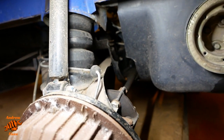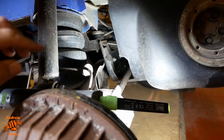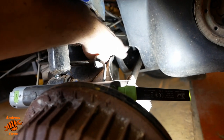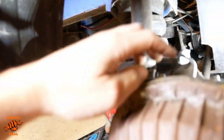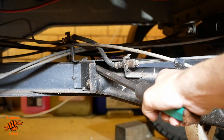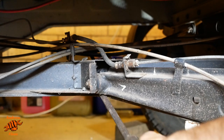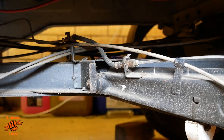While we're here we can do the same checks for the bushings. At the back there's one at the end of this arm, and then there's one at the end of this arm as well — just get the lever in there and have a swing on it, make sure it's nice and solid. Not got any obvious play. That one looks absolutely fine — and do the same with the rear one as well.